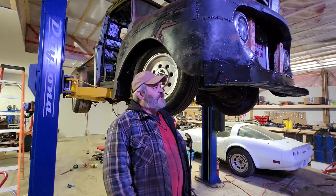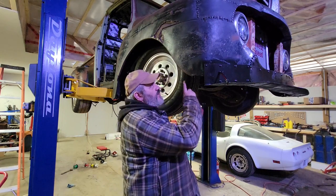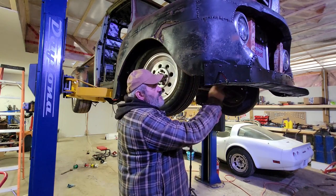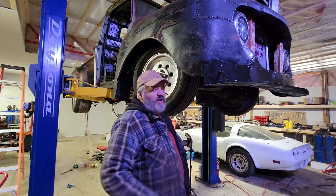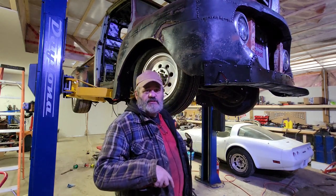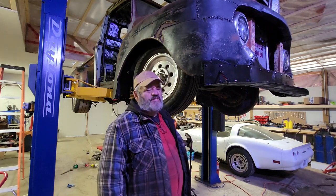Spread a little bit of POR-15 to keep the rust under control and sprayed it up underneath the back here because she's real rusty back there. I don't want it to rust more but I don't care about the rust that's already there, so it just kind of seals it all in.